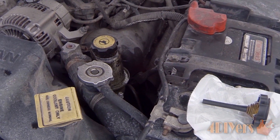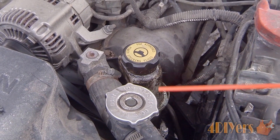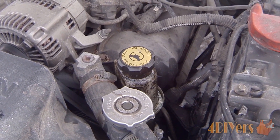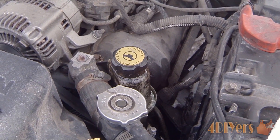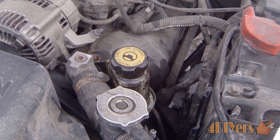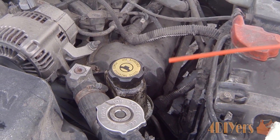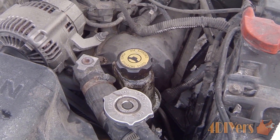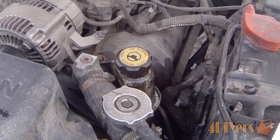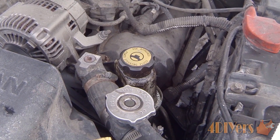As I mentioned, what happens with these power steering tanks is that the pressure builds up and you will notice excessive pressure in the system when you remove the cap. Other times you may find that the o-ring will also be very swelled up and very hard to replace back onto the reservoir tank. What this can cause is leaks throughout the system — it's going to find the next weakest point and the system will continuously go down on power steering fluid.